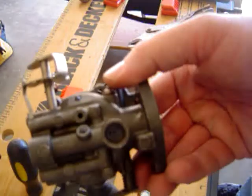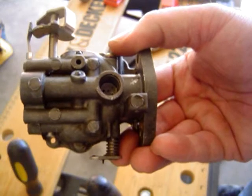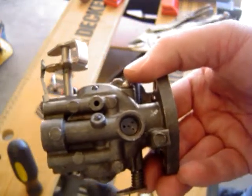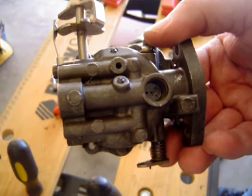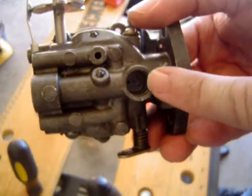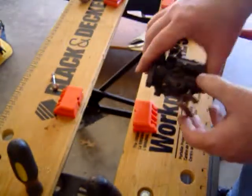There are three little holes down at the bottom. Those little holes help with the fuel and mixture. There's a little bit of dirt down there, but it's basically clean, so we probably would have been okay not changing the expansion plug out. For a lot of times it's not necessary. But if you bought a kit and the carburetor is really dirty, or maybe you had trouble running it — really crummy idling with good compression and good spark — then chances are it's a fuel issue. If it's not idling low well and you've adjusted everything, then this may have a little junk in there. So what we're going to do now is clean up our carburetor.